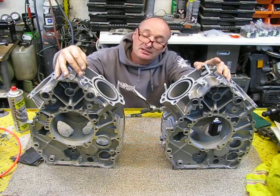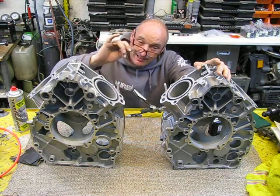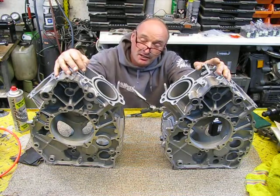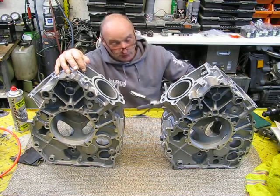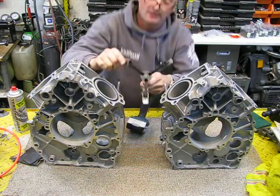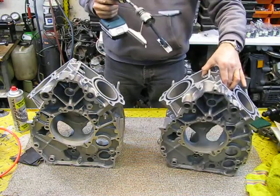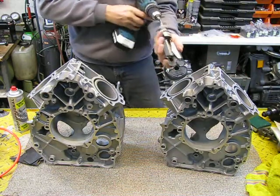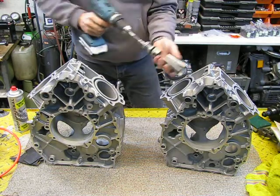What we want is a little scratched surface. When that is there, the oil will smooth out and the piston rings will do their jobs better. I have the special tool here. You can buy them. It's with grinding stones on the top of it, and it's very simple, and because they are in line with each other and a long based element, they will find their way in the cylinder sleeve.